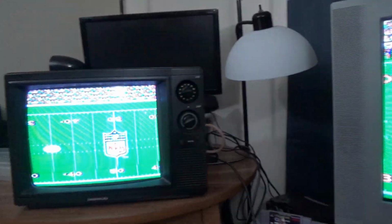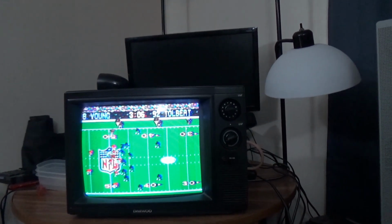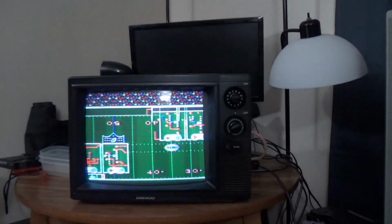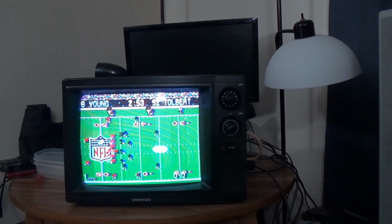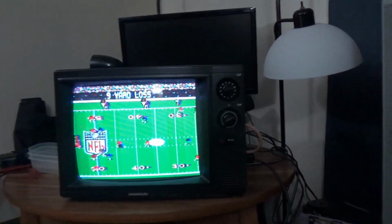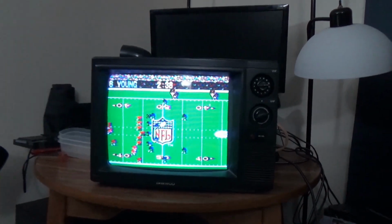The big thing here, though, is I could have reached in very, very carefully with some high voltage gloves and a little Phillips bit to turn that little potentiometer and fix the horizontal on this thing. The problem is, I think the risk-reward isn't really worth it. The TV is perfectly functional except for the completely fried potentiometer for the volume. And we can bypass the built-in speaker entirely these days and just run the sound as something else, and just use this as a monitor.